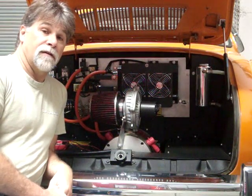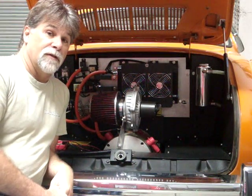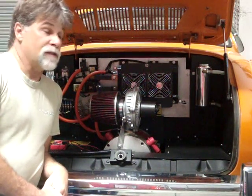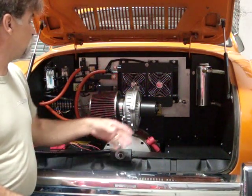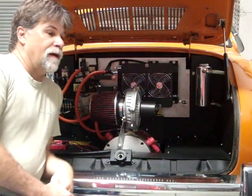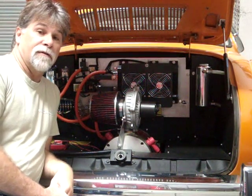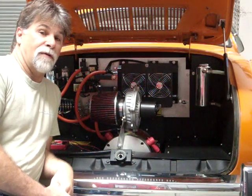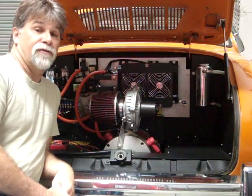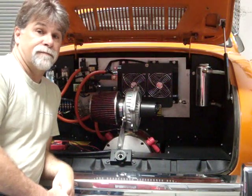And so the other morning, the Curtis gave up the ghost. So we did some testing to make sure that that's what it was. We checked our voltages. We checked to make sure that we had voltage at the KSI connection. We checked our throttle, to make sure that was working properly. And so everything points to the Curtis as being DOA.